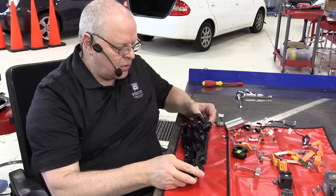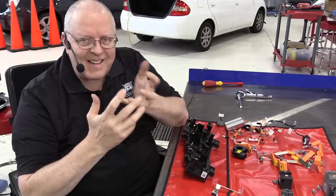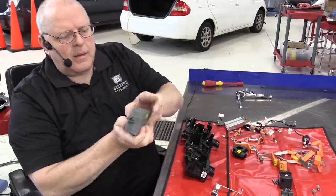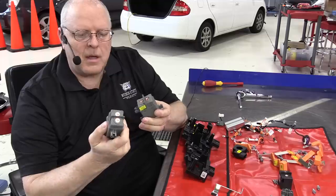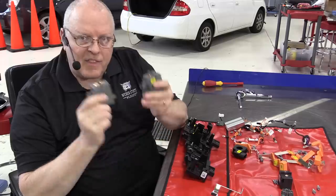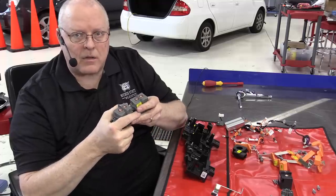the individual pieces. So inside of this battery disconnect unit, there are some major pieces that are common to any electric vehicle, or even a hybrid electric vehicle. We have two, some people call them relays, some people call them contactors, but we have two great big heavy-duty contactors. One is called the negative contactor, and one is called the positive contactor. And these are the devices that connect our high voltage battery, positive and negative, to those two great big heavy orange wires that connect to the front of the battery.